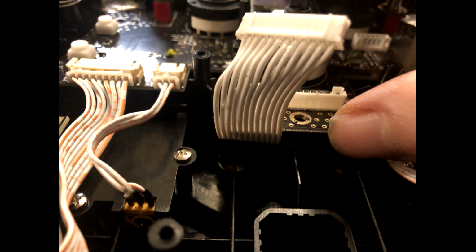There are, I think, 7 small cross-headed screws holding the PCB to the wheel. We're not going to remove the PCB, so leave all the other connections attached. We're just going to undo the screws so that we can move the bottom of the PCB, where the loom attaches, enough to pass it underneath. We're undoing all the screws so that when we lift the PCB a tiny bit, it doesn't have to flex. That's all the lift we need, just a few mil.